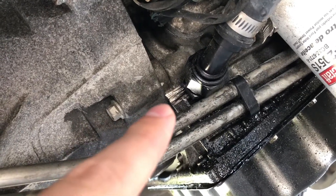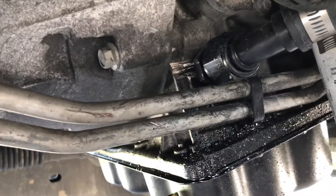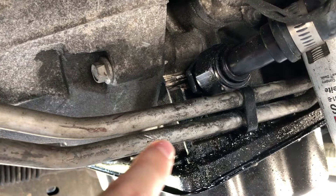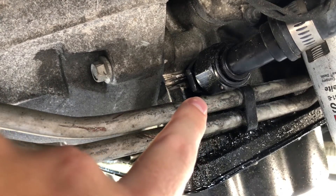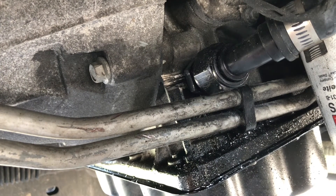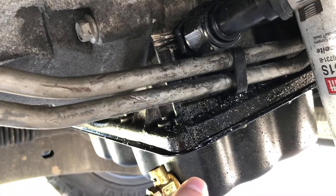You can see right here — that's where you gotta grind away some of those fins. It's kind of hard to see with the trans lines on, but you can kind of see right there. This fin goes up like that and you gotta grind that away. Then you can thread in there — they give you the threads and everything. Pusher Intakes does the tap and everything.